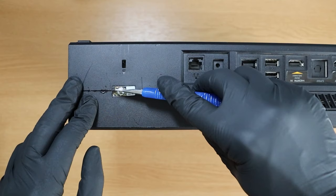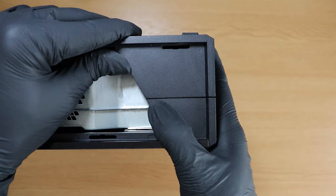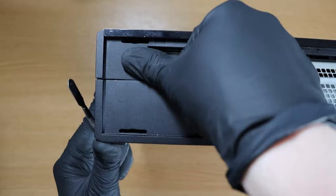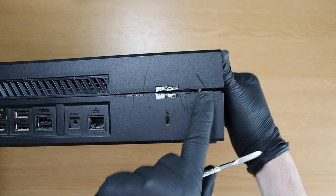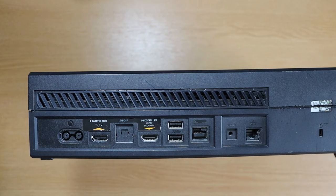Next we're going to take this triangular shaped part and slide it away from the sync button. Now we divert our attention to the backside of the Xbox. Here you'll see the warranty sticker which you'll need to cut to open the case. Go back to the side where we removed the plastic grill. Upcoming is one of the most tedious parts. Push down and away on the smaller piece of plastic to undo the clip on the inside. Be sure to try and hold this separated as it will make your life easier. Where the warranty sticker is, there is another clip. Simply insert your prying tool and repeat the same down and away motion to separate the clip.